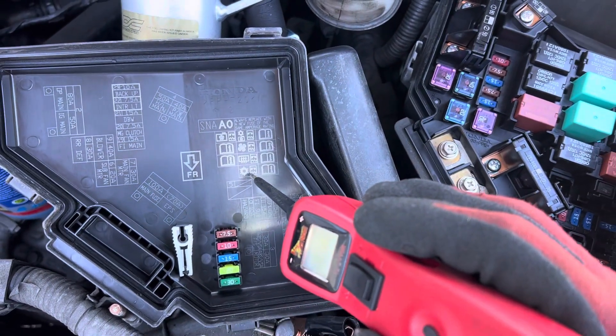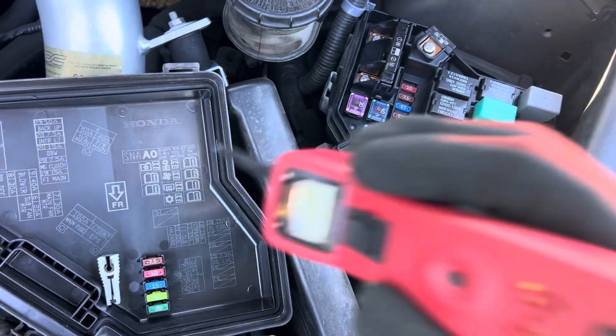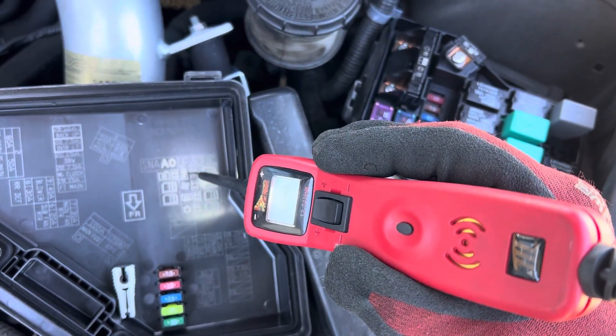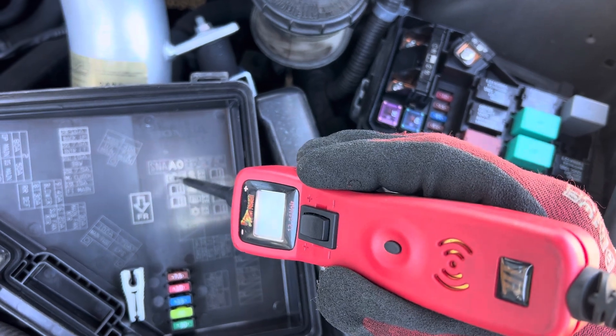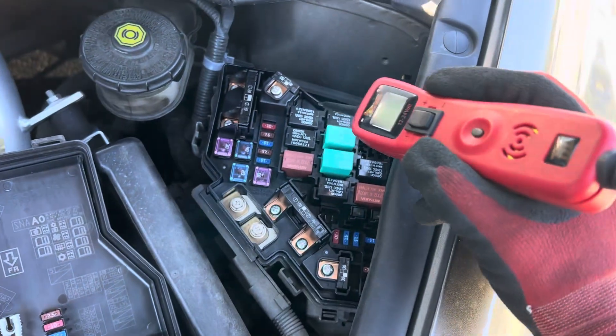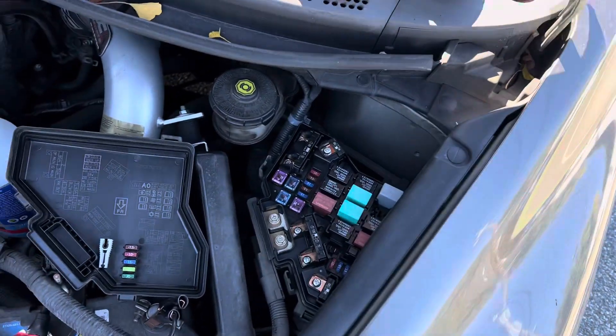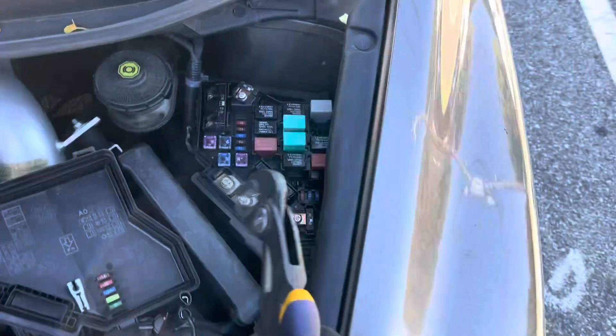See the snowflake right there — that's your magnetic clutch, this one right here. One, two, three, four up at the top. We can hear the fan going, and then we have another one for a fan and another one for a fan. We know the fans are both working, so that tells me the fan relays are good. Let's give this all the magic persuasion.